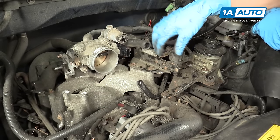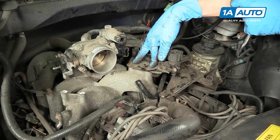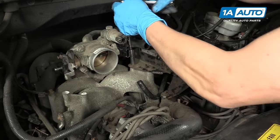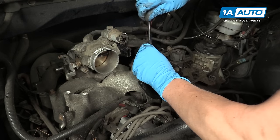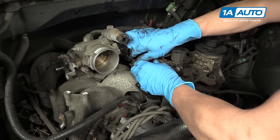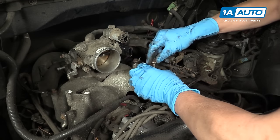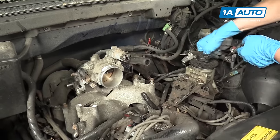Right here there's a couple of connectors that are plugged into this bracket. We're just going to remove the whole bracket since it needs to come off the intake anyways. We'll start by pulling these two 10mm bolts out using a 10mm socket with an extension and a ratchet. Just be careful not to drop them down into the intake area or you'll have to fish them out with a magnet. I like to put them back in place so I know where they go. Then you can move this whole thing right out of the way.